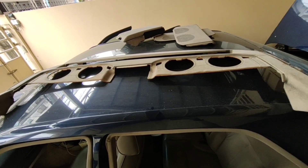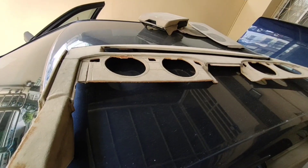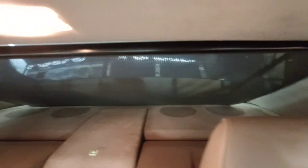This piece of rear deck will go back in later. Put back the three nuts securing the curtain to the rear deck and tighten them. The rear deck is next, then the first aid compartment and the speaker cover. Now you can enjoy the shade in the rear seat. Thank you for watching.